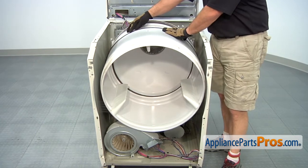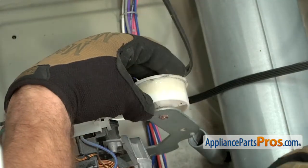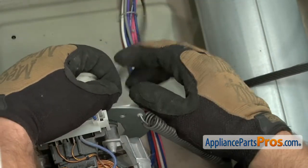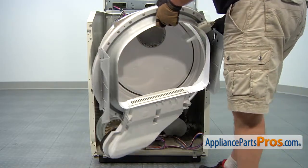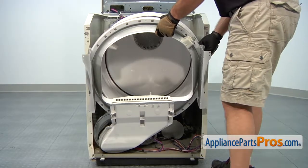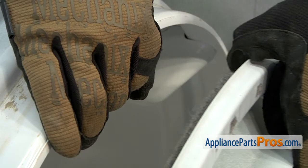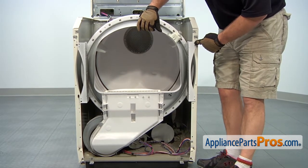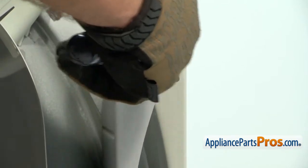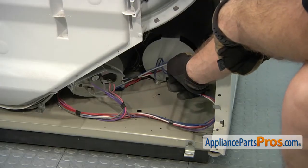Once you have it in place, make sure that the grooves are towards the drum. Then we can go underneath and wrap the belt around the idler pulley. First we want to grab the idler pulley and pull it towards the side wall with your left hand, then use your right hand to make a loop in the belt and put it around the motor pulley. Now that we have the belt on, we can put the front bulkheads on. Make sure that the seal is lined up with the blower housing and that the drum rides on these glides. You may have to lift up on the drum to get it to go in. Once you have it lined up and pushed in, we can put in the 5/16ths screws to hold it in place. Remember we only had 2 screws holding this in.